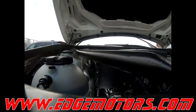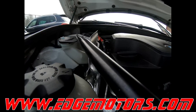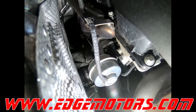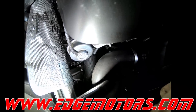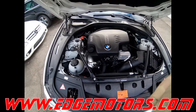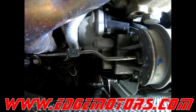The rattle noise comes from the wastegate. The reason why it rattles is because the wastegate got a bit loose and it needs to be tightened up. In this case the wastegate doesn't close all the way, so when you're driving your turbo is not spooling to the full boost. This is the wastegate rod connected to the turbocharger.